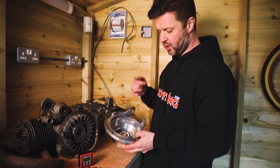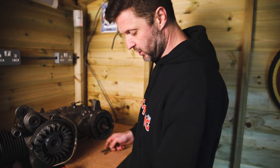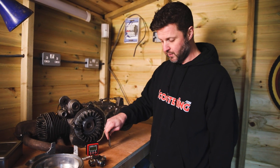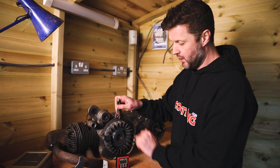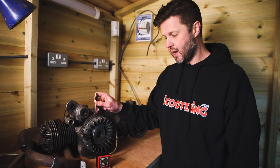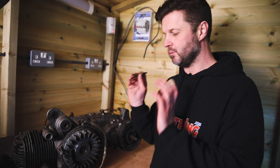One way would be to simply measure the diameter of your mag flange, then use a protractor to draw that exact replica in a circle. Once you have that circle on a white piece of paper, you can use a degree disc to mark 17, 18, 19, 20 — whatever — and measure the distance between those two points. Then all you need really is a positive stop tool to find your top dead centre, mark that point on your flywheel. That's the tight way. This is the right way. So anybody who's a home enthusiast who just wants to get their timing around 17 degrees — a bit of paper, protractor and a compass, easy job.